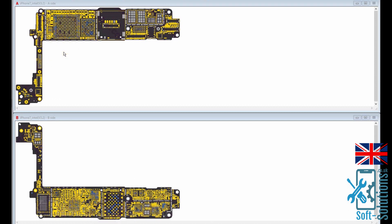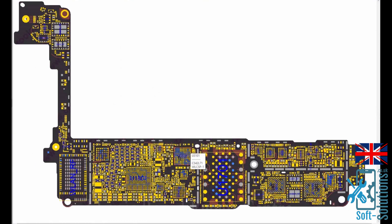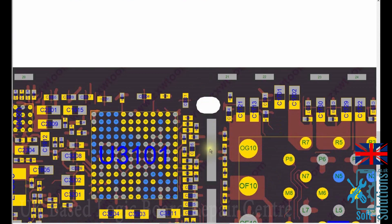Let's go to the ZXW tool and I'll explain there. We have the ZXW tool open with the iPhone 7 logic board — that's the top side and that's the bottom side of the board. We need the bottom side because our audio IC is right here. What actually happens when your phone gets bent: this area is the weakest point of the motherboard, so when the phone gets bent, the motherboard bends and the traces at the weakest point get disconnected from the audio IC.